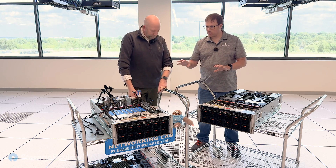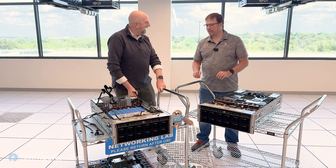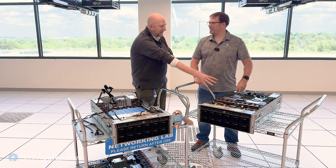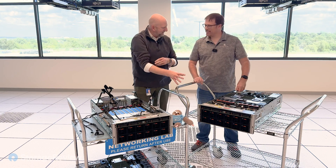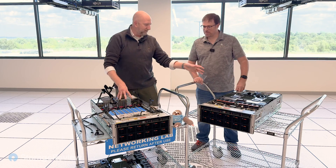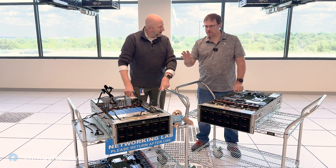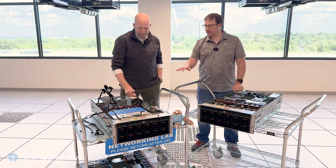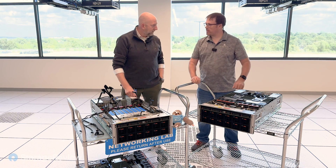It looks like it's kind of a 1U server made into a 3U JBOD shelf. It's more like a G-BOD — a graphics card box of disks — and on this side it's an A-BOD because it's an accelerator. So we've got GPUs and accelerators, there is a difference between the two. There are fans on the front so the compute layer and GPU layer both get their own discrete airflow and both get the cool air that they need.